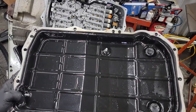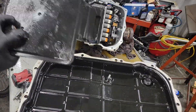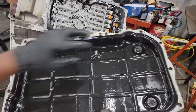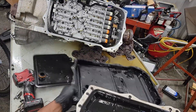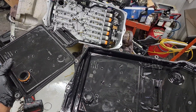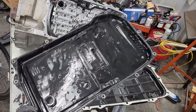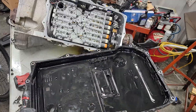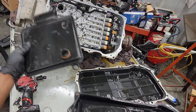If you want to save money and extend the life of your transmission, service it. This is just my opinion, but if you get the steel pan you can continue servicing it this way — you'll only have to drop the pan and take your filter off, as opposed to the plastic pan. I'm almost certain the plastic pan assembly is way more expensive than the steel pan for continued service. The manufacturer suggests servicing between 50,000 and 60,000 miles. Draw your own conclusion on whether you want to service your transmission, but you can swap pans and replace the filter — only on a steel pan.